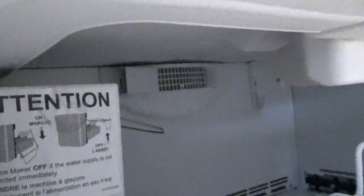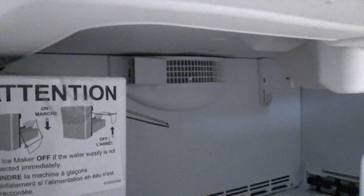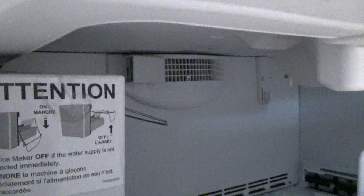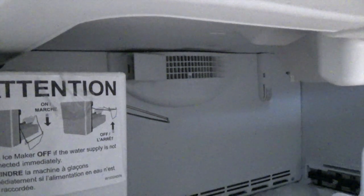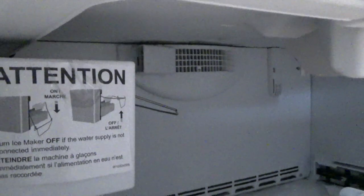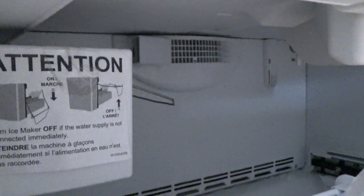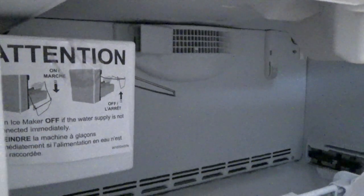I guess this is because it's not condensing correctly — that's what I've read. There's a vent up here, and I've been told you can take this off, take the back panel of the refrigerator off, which requires you to take out both drawers. Then you have to go into the back of the refrigerator and clean the drain valve. I've not only cleaned the drain valve, I've actually removed all obstructions — removed the little rubber tip — everything, you know what I'm talking about if you've got one of these pieces of junk.